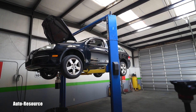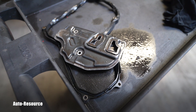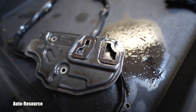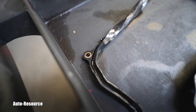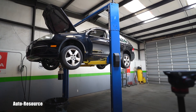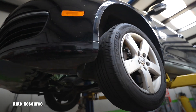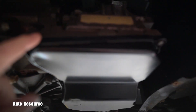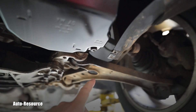The fluid was black, which is bad — but when we got the pan off, the magnets had only minimal, microscopic shavings. There's almost nothing visible in the filter mesh. This is the old gasket with spacers, so I can finally throw it away. We replaced the filter inside the transmission and replaced the gasket with those metal spacers, and everything is torqued.